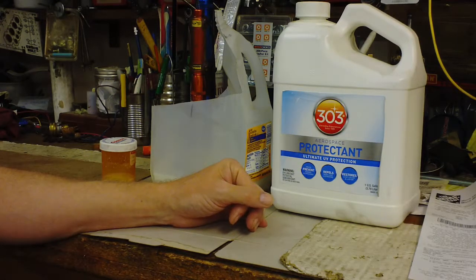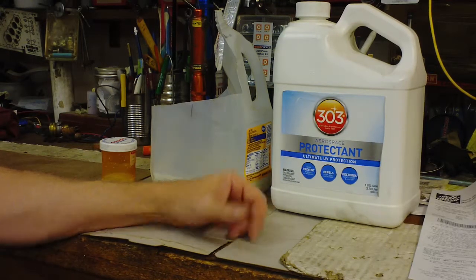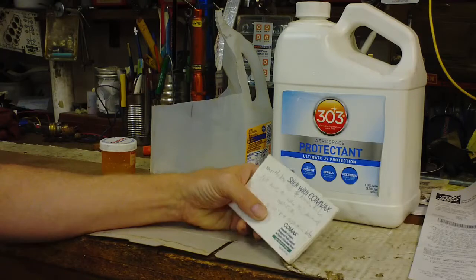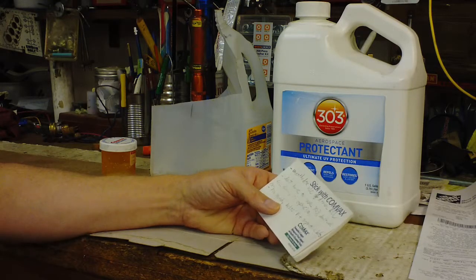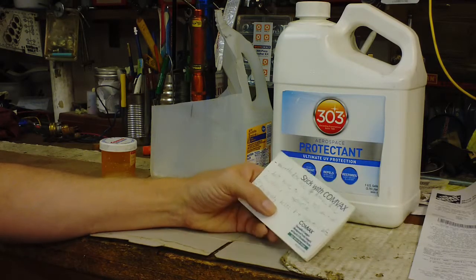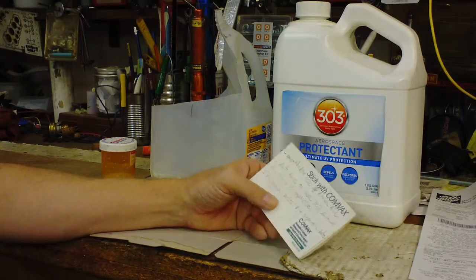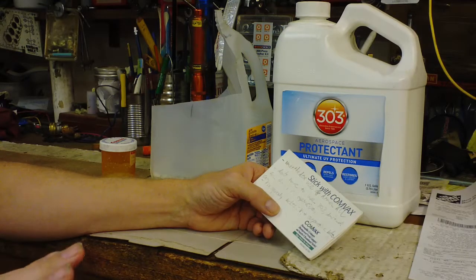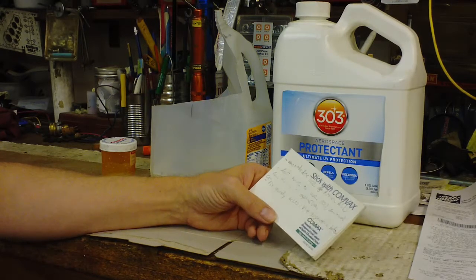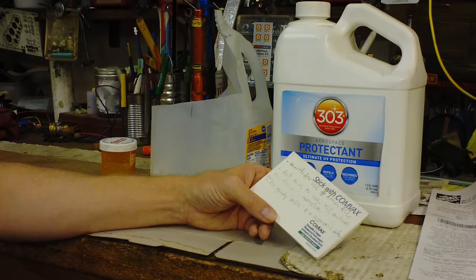It can help with all that awful, super annoying squealing that goes on, especially right when you start a vehicle up and it's charging the battery hard. Of course, first you need to double-check that the belt isn't worn out and doesn't need to be replaced, and make sure it's snug and not loose. If it's still squealing, you can clean it carefully — if it's running, be very careful because it'll eat a finger and ruin your day.